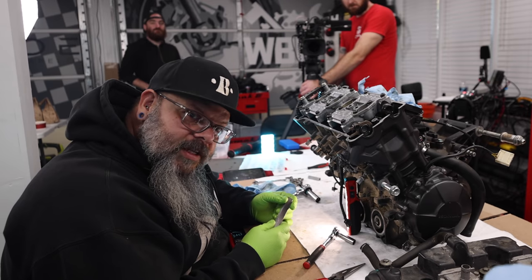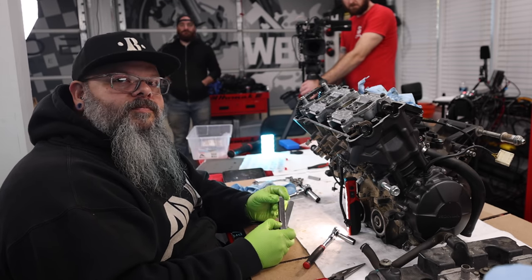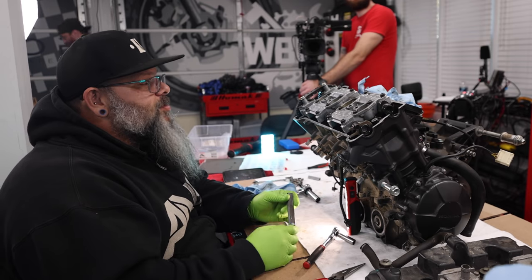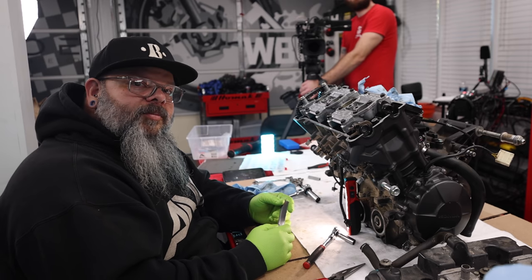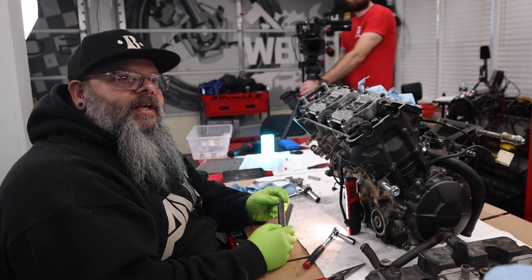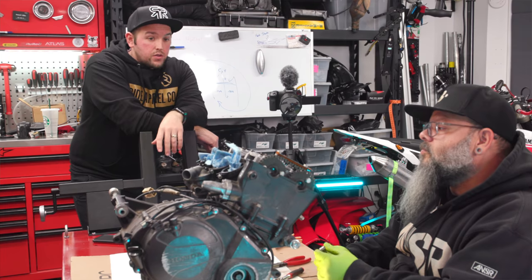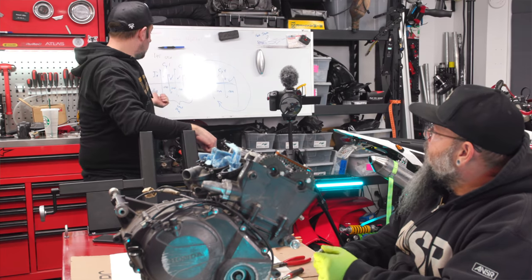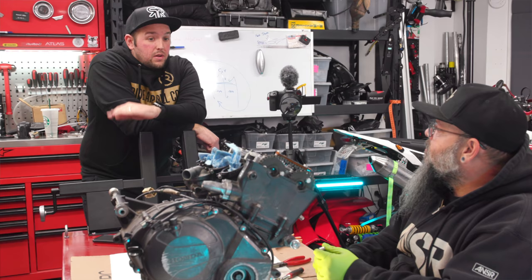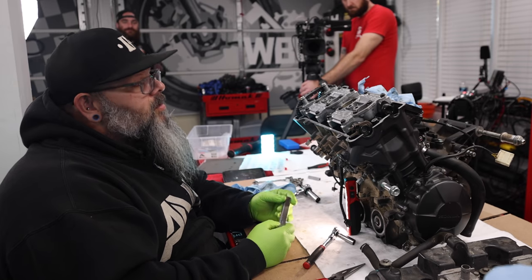Okay. So we still need those four 195 shims, and everything else in here is good. And then we still have to go through all the intakes? The intakes I just measured, and they're all within the bubble now, because they were all, except for two, already in the bubble. I changed those two shims, and now everything is within the bubble. So in that case, four shims, and we can take the cams back out, swap the shims out, put everything back together again, and that's done. But since we're not doing that on this video, we're good to exit now? That's a full valve adjustment.